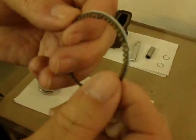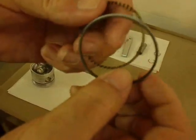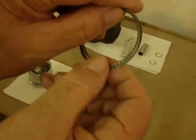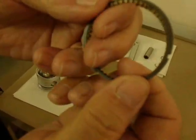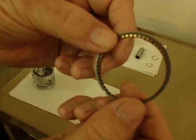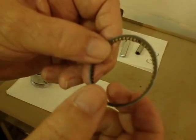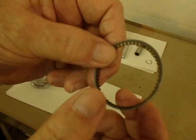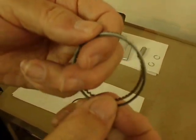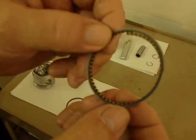So when it's properly installed, the inside diameter of these little thin rings will be a little bit bigger than the separator ring, because these thin oil rings will not go all the way in and touch the bottom of the groove. I spent a little bit of time on that, but it was important — it gave me a lot of problems. You'll know when it's right because they'll be locked together and they'll all move together, and you'll also be able to compress it. If you can't compress these rings when they're on the piston, then something is wrong. One of these rings may have slipped alongside the separator ring and be down in too far, so you need to get that right or you'll never be able to get the piston into the cylinder.